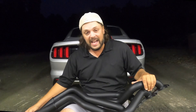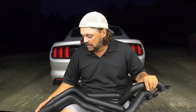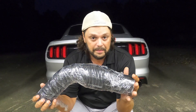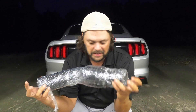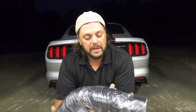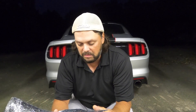I know a lot of you are thinking — with these headers, they do relocate the O2 sensor. The workaround for that I'll get to in just a second. Behind the headers, we're actually going to run cats. Yes, you can go catless. Yes, you can pass emissions with catless and everything like that, and yes, if you're looking for the last word in power, catless is probably the way to go. I didn't want to do that. I want my car to be able to be inspected pretty easily, especially with everything that's going on right now. So we're going catted because it's just easier.